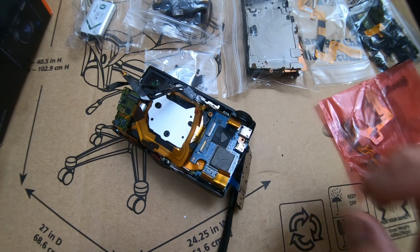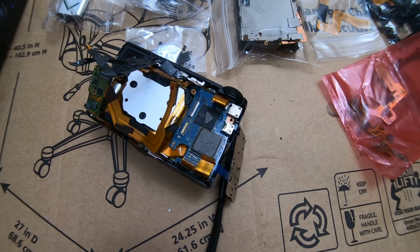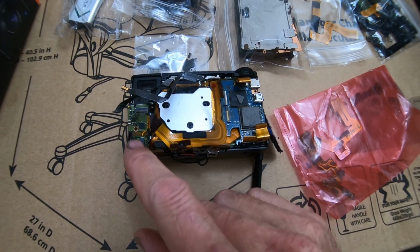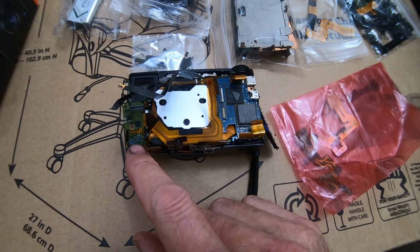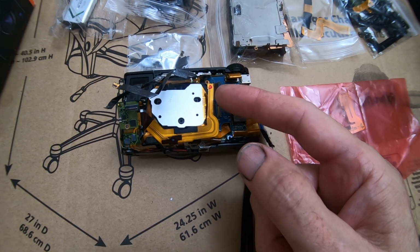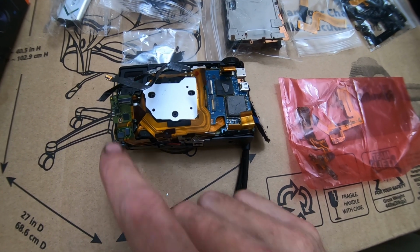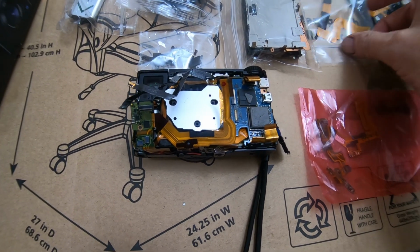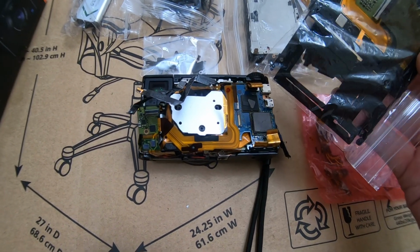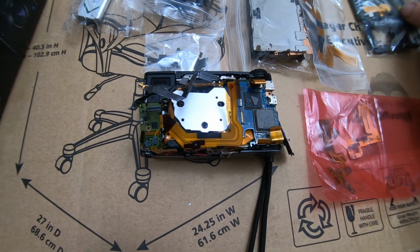In all my videos, I say never take the CCD off first. You always take the lens out and then swap it. That's how I do it in all my videos. So this cable is that cable right here. That's with this little board here, and I think that's a flash or something. Can't remember. But that one plugs in right here, and you see right there, all the connectors are ripped. So that's messed up, and then it has some solder points down here for the speaker, and then it goes in there on that little flash thing, iView or whatever it's called. Then this one is for the LCD, and somewhere this one is ripped. Let's see, where does that one go? It's in there somewhere.